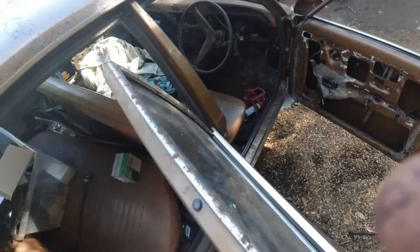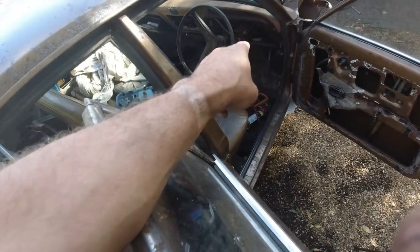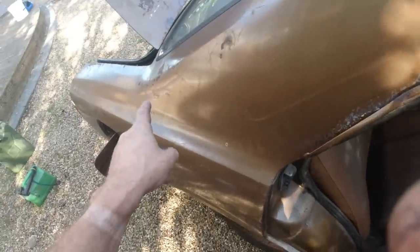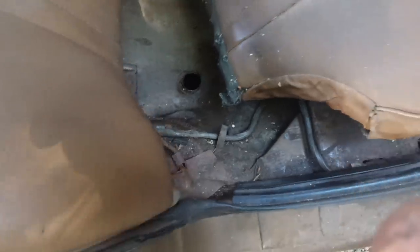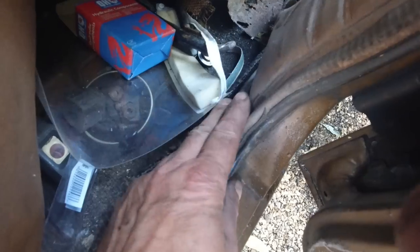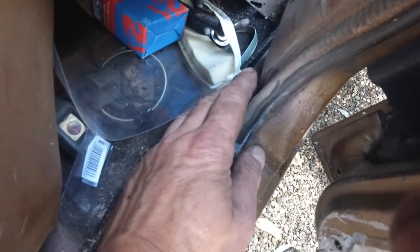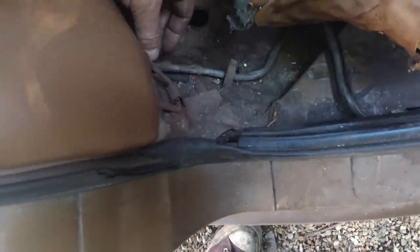So there's a break in the cable. Indeed, if you put a continuity tester pin, if your leads were long enough, you'd put it on that pin and you'd put it on the sender and it would be 0 ohms, because there's a break in the cable, and the break in the cable is going to be here. And when you do it, I usually go for halfway first, so I'd have gone for here, broke in here and seen where the short was, and if it's earthed up to that point, then it must be further up the line or further back down the line. But as I lifted the seat to do it, I spotted this, so that saved me some time.